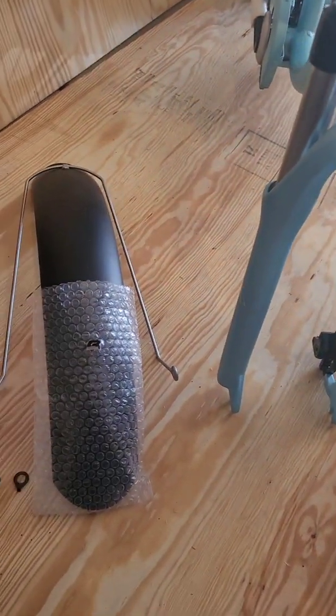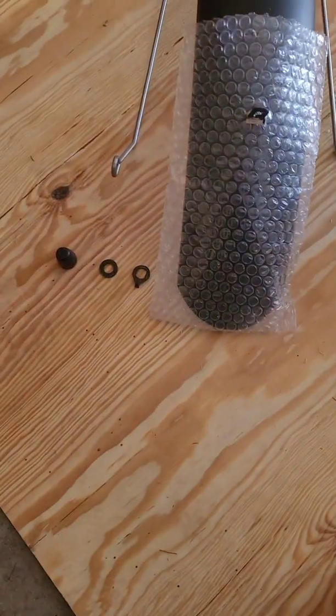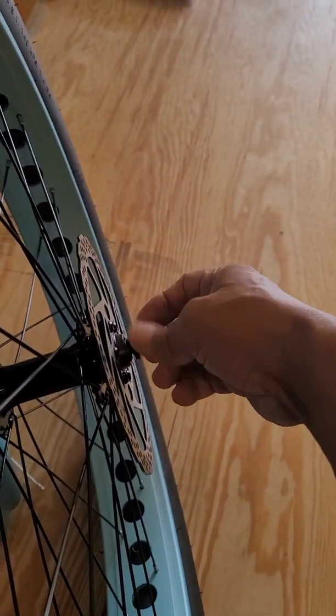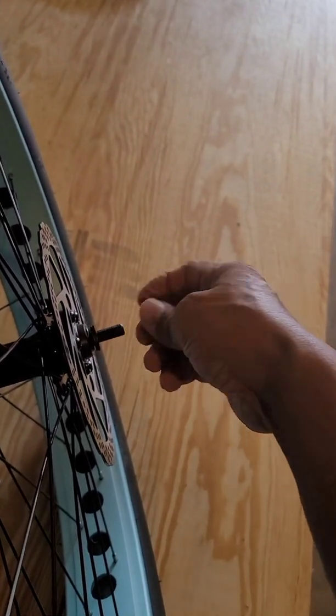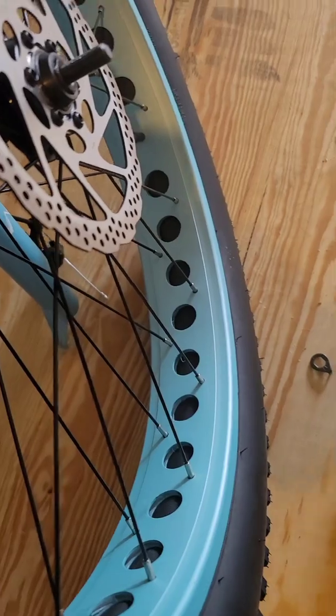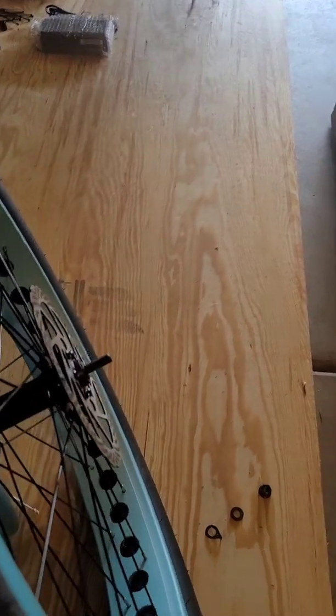Okay, so as I'm putting the front tire on, I just wanted to point out, as you take things off, I pulled these 3 pieces off of this side of the axle, and they're over here too, the same 3 pieces. That's the order I pulled them off in. So when I lay them out, and you should do the same, it'll help you, because this is going to be a 2-step phase. You have to put the fender on when you put the front tire on. So just lay these out. That's the order they go back on. Just pointing that out.